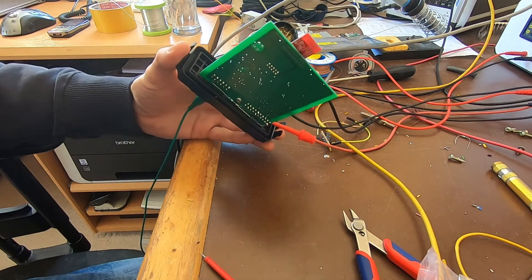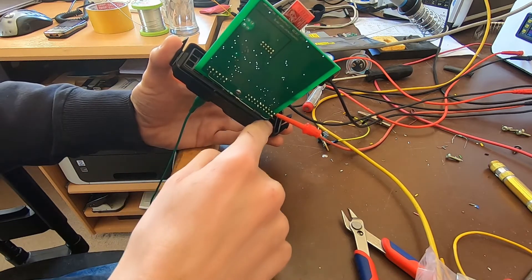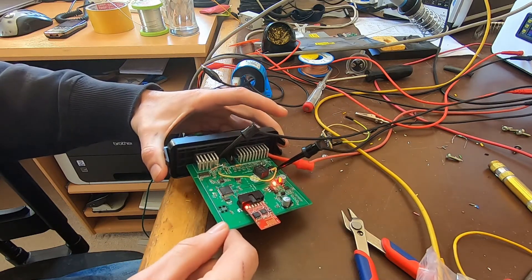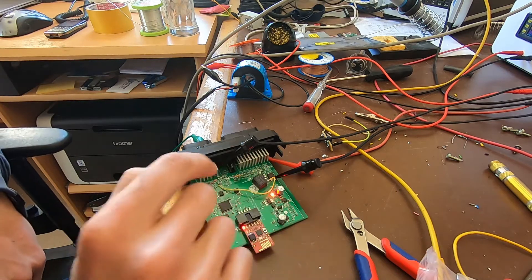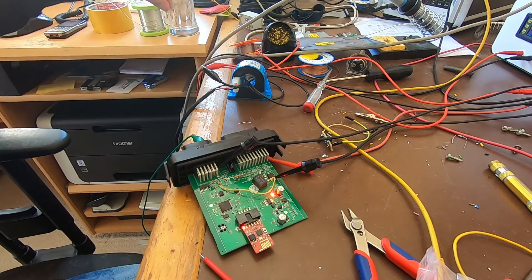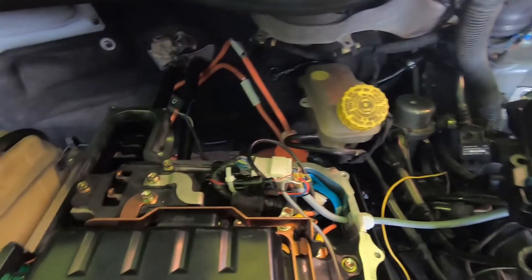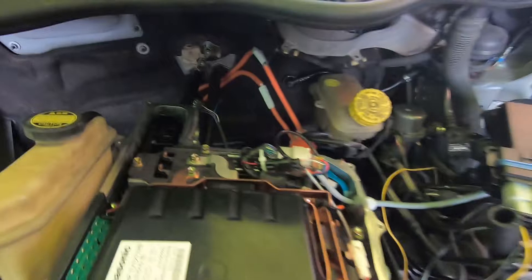Hidden down here we can see a Schottky diode. These are the forward/reverse inputs, which I've short-circuited here. We use them to signal that we're now in charging mode: 12 volts are applied to both forward and reverse simultaneously. This switches the relay on one side, and on the other side these 12 volts are also fed through the diode onto what is normally the 12-volt input — meaning we supply the car with 12 volts via this diode so it can charge. The current then, after being regulated by this electronics, goes through our normal DC lines to the battery at the back and is fed in there.